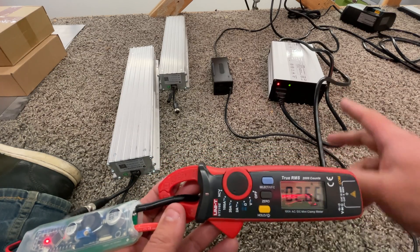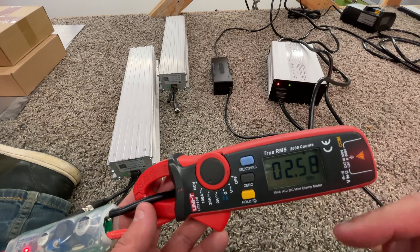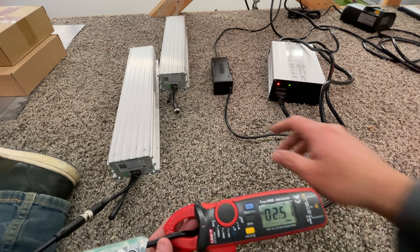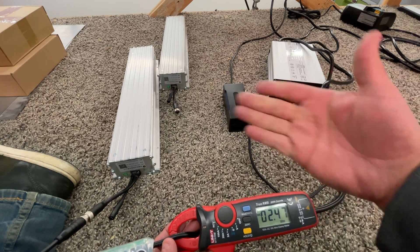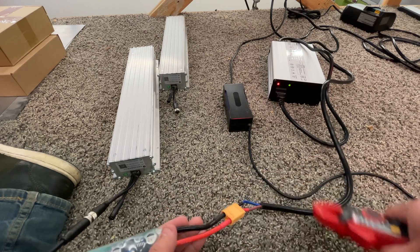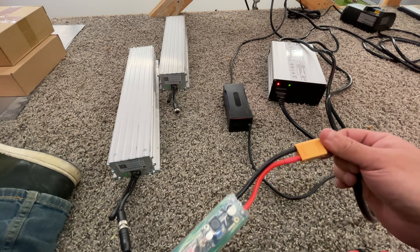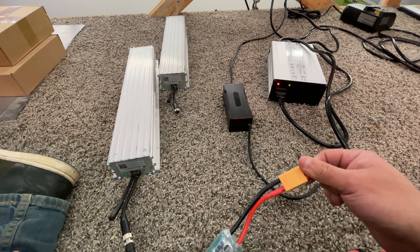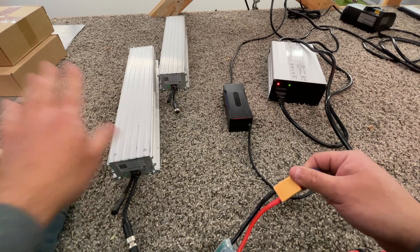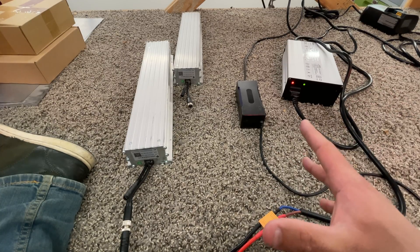It's at the voltage where this charger recognizes the battery is almost fully charged, so now it's tapering off and it'll go down to zero amps, then the charger will turn off. The big charger needs a battery that is not completely dead; the small one you can use on completely dead batteries. Then you'll have to wake them out of hibernation, and after that just use your dongle. It's a bit of a process, but you should only have to do this once. As long as you don't let your batteries go completely dead for months, you should be fine. But even if that happens, you'll just come back and wake them up individually.